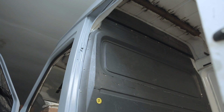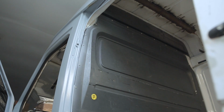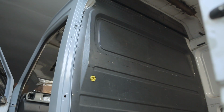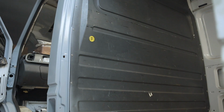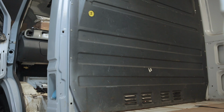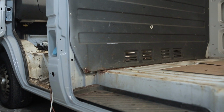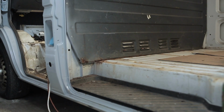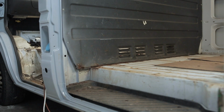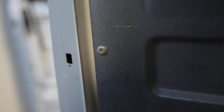Mulling over the type of cab you're going to go for in a camper build is a big one. See, a bulkhead can impact a number of key requirements in your build. You're not listening to an expert here, but you're getting told anyway. Think about road noise. Van's drum. That's the hollow din created by the rear walls and roof wobbling and echoing off each other when underway. And it's become the done thing to glue heavy bitumen or rubberized sound deadening all over the inside panels of the rear end to kill the noise that invades a walk-through cab.